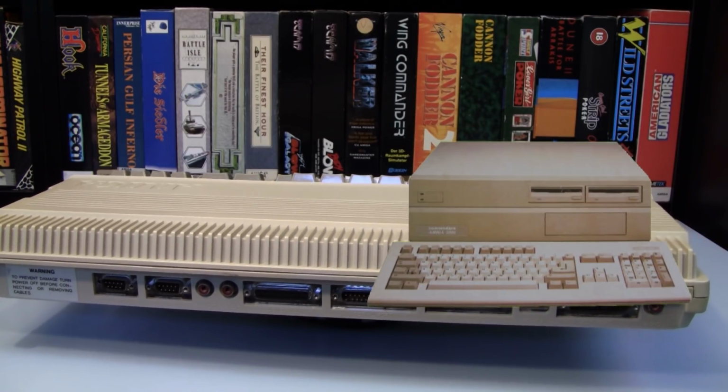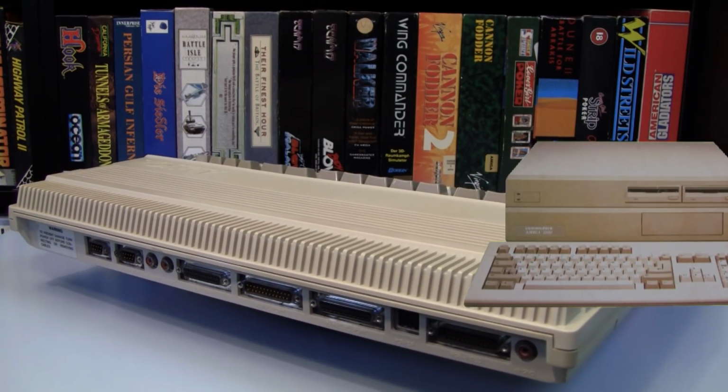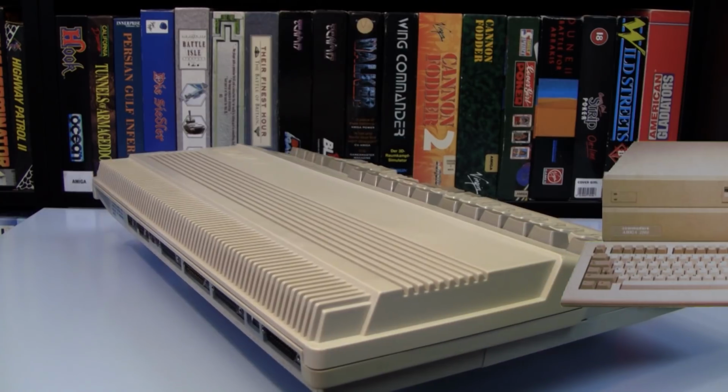Then there is a slot for a CPU upgrade, another one for a video card, then 5 Zorro slots for all kinds of expansions or RAM upgrades, and 4 ISA slots, which, if I'm not mistaken, can be used to make the Amiga 2000 also PC compatible.